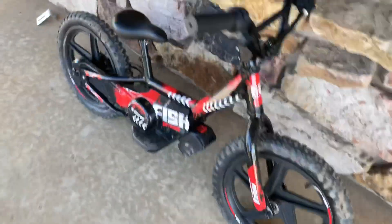So we're going to go pick this bike up and obviously we're going to diagnose it. I did get one in that was actually stuck on high — the switch had one of the prongs bent. I bent it back and it worked 100 percent, that's all that was wrong with it. Personally I thought the prong was too long, that's what caused it. Let's go grab it and see what's up.